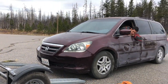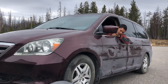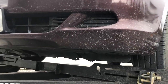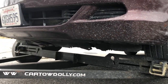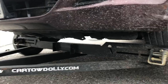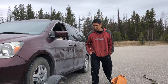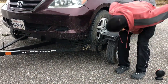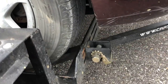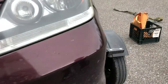Something very important to remember when loading the van or any vehicle on these tow dollies is that you're perfectly straight. I use my right pedal to control the gas and my left pedal to control the brake, and that helps me to get on the ramps better. So what I always do is I get out and double-check the wheel — the front right tire is not up against the stop like it should be. See that big old gap right there? That doesn't work well. We need to come back off and make sure that we are on completely straight.